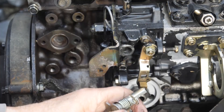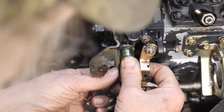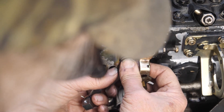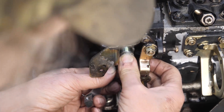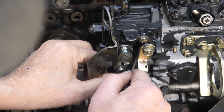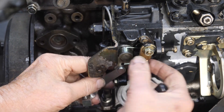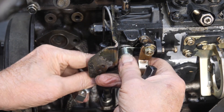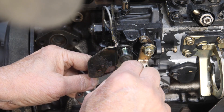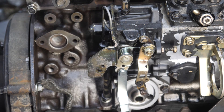To help with installation, I'm going to put a little bit of assembly lube around the shaft and O-ring. You kind of have to rock and roll this when it goes in because it has to face those pieces inside, putting a little pressure on it until it goes in. With the shaft in, it's going to be a bit tedious to bring the spring down and put it over this bolt, so I'm going to bring that shaft out just enough to give me some room to clear the head of that bolt. I'll shut the camera off for now and get it done.